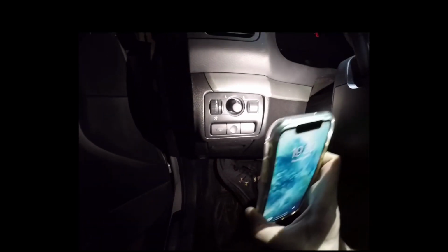So it took me a 2008 plus steering column with the telescoping feature on it. It took obviously the newer 2008 plus column covers. Let's see, I had to get a new kick panel right here for a 2008 plus, so that my steering column would be able to tilt and telescope properly.